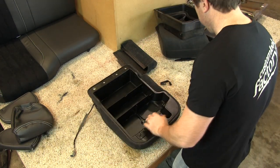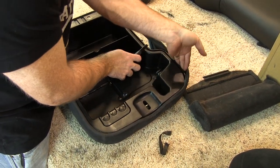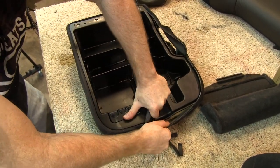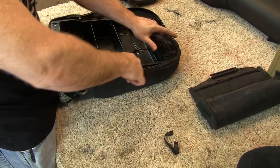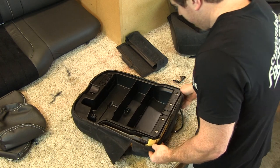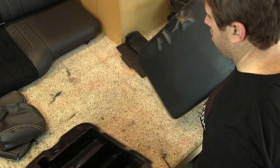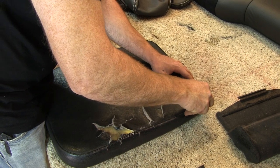With the frame completely disassembled, we use a stuffing tool to pry the plastic welt cord attachment out of a channel in the factory console bezel. With the upholstery removed from the upper console backrest area, we moved to cutting the vinyl cover off of the console lid section.